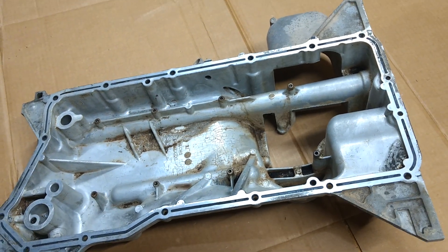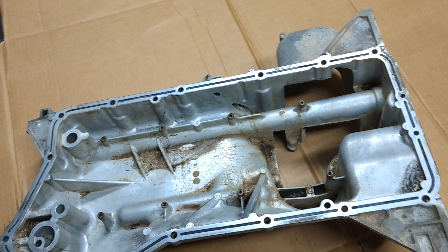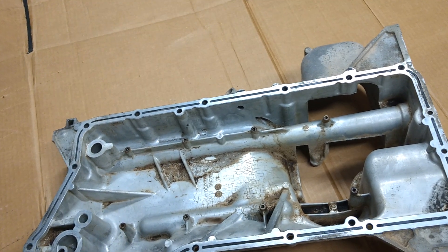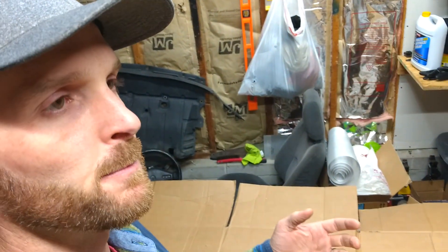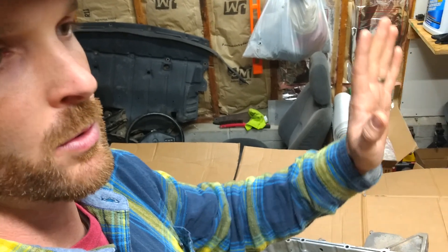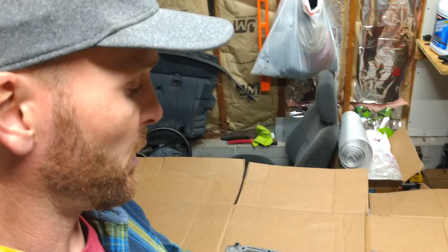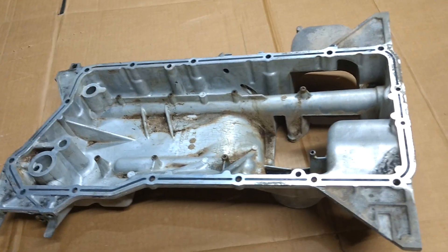From our experience messing with it, we've made a couple — like one rough prototype and then one that we sent off. We've made two full, complete, not reusing anything factory — like full custom front sump oil pans for the VK56. And they incorporated so much stuff in this factory pan that it's a real headache to try and make something from scratch.